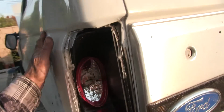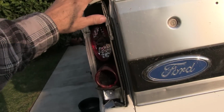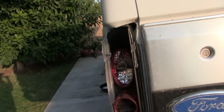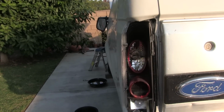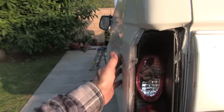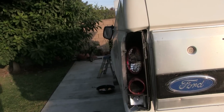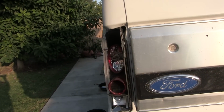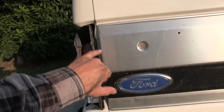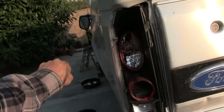This rear panel is in. See how far it's in there? I'm just guessing maybe a 1/4 inch. I'm thinking I can pull it out myself. Now I'm not going to take care of the body work, but at least I'd get it fairly straight and then take it to the body shop where they just need to take the dents out. So I'm thinking of maybe pulling it out with the winch on the Tacoma. That's the theory anyway. I have to block it from the inside somehow, maybe drill some holes, put some bolts in there, and then hook my winch cable up to there, and then just pull it a little at a time till it pulls out far enough.